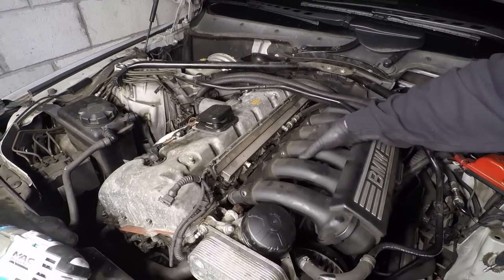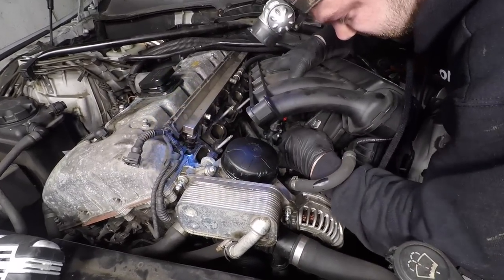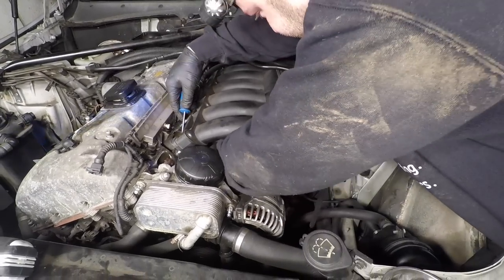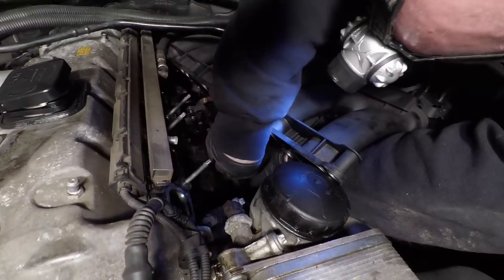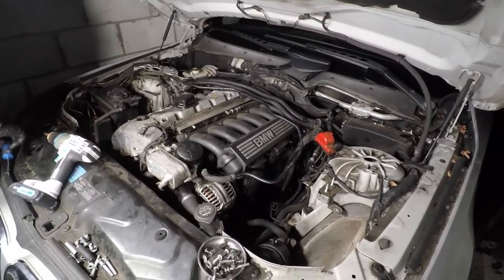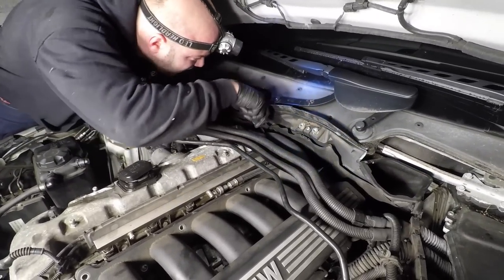The manifold is now free. Just pull up like that and it lifts. As you can see it's already released, but I need to disconnect the other DISA connector for the three-stage manifold, the PCV heater, and then we can take the manifold out. Get underneath and prise off the DISA valve connector with a screwdriver. The only other thing to disconnect is the crankcase vent hose. Get to the PCV — that strap was in the way. Don't worry too much if you break it — they do break regardless. Usually once these are on you can't get them off without breaking them.